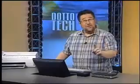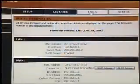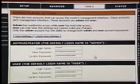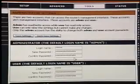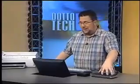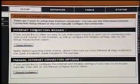Now, the first setting that you should modify is not allowing people to log on just with the name admin and no password. So if we go into the tool area here, we can adjust the administrator settings, giving it a reasonable logon name, making it more difficult for people to access, and giving it a password that's not just a wide open password. Otherwise, people can come in and modify your router, and they could even shut you out of it, which would be pretty upsetting.